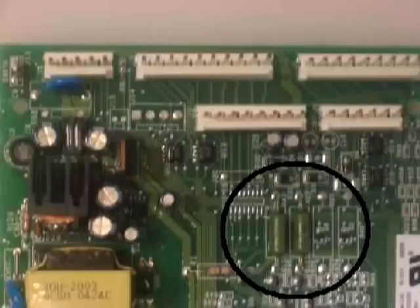Also, if at any time you diagnose the main board being bad, look just under the J2 connector. There will be two resistors. If one of those resistors is burnt, replace the main board along with the fan that isn't operating. This is because a shorted fan motor will cause that resistor to burn, and if you do not change both, your main board will fail the same as your old one.